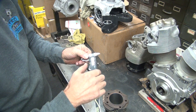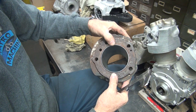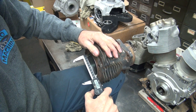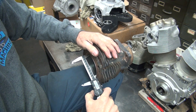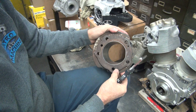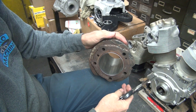Found my caliper - newer than the other set I was using. This is pretty thin up here - that tells me it's a pretty damn big bore. Nope, doesn't measure very big though: 3.468. So that's 70, that's 40 over. Why is that lip so thin? This thing's been cut down - this lip's been turned down.